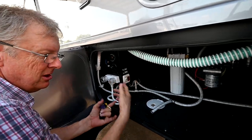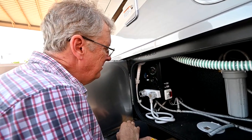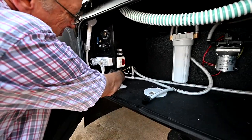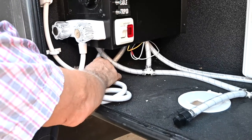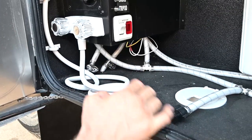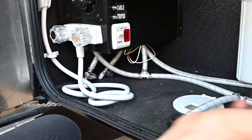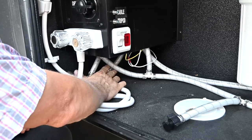You can also set up a tripod satellite outside in a clearing and hook that up to a satellite receiver inside. There are also low point drains — right and left — that allow us to drain the coach for wintertime, or if we just want to drain out the bad water. We open those up and they drain straight to the ground. Open all the faucets inside to get air in the lines and help move the water out.